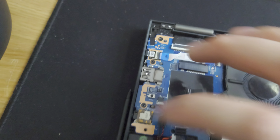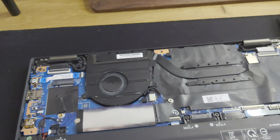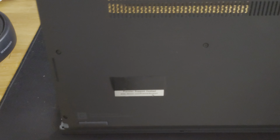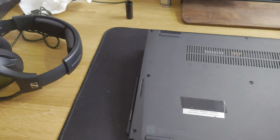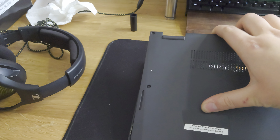If you want to change the battery, it's very simple. Undo these five screws, then simply pull up. There are tabs under here, so when you install the new battery you need to slot the bottom end in here and then get the connector pushed in.